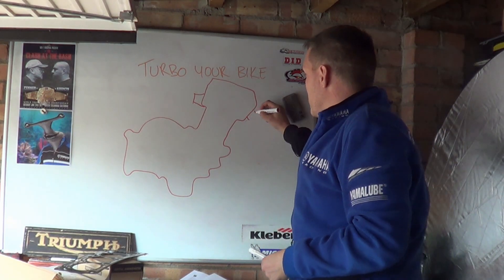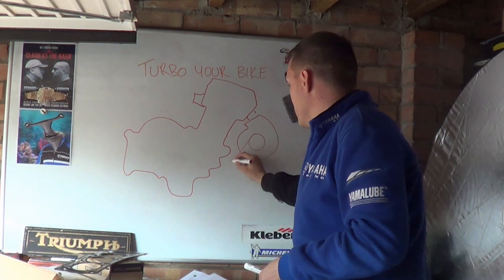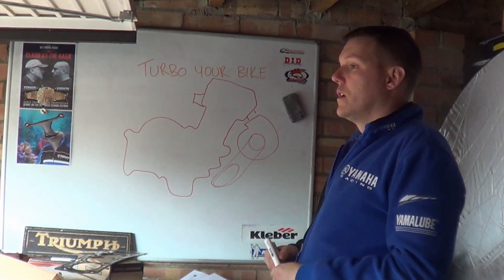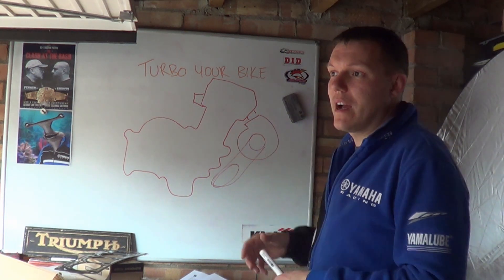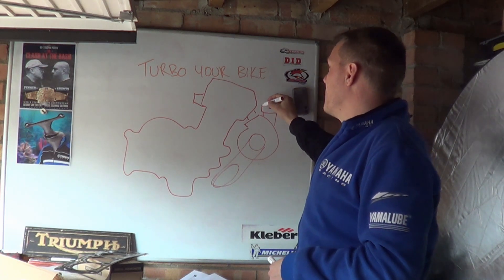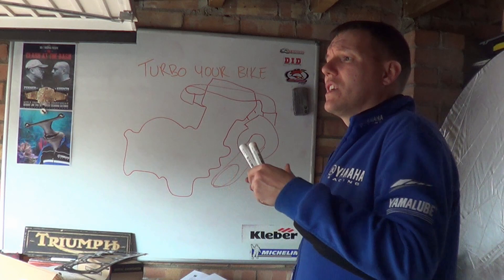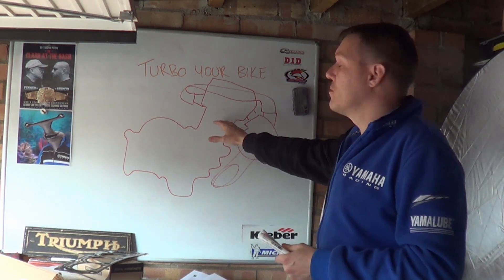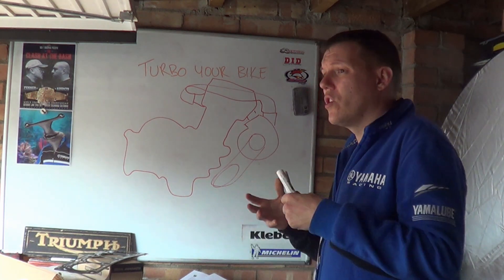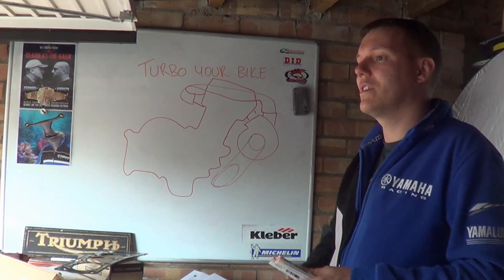What you have to think about is the placement of things. Obviously your exhaust port is here, so you want your turbine sat here somewhere. Then you stick an exhaust on it that might come out like this, or you might actually fit it to an entire exhaust system — it's completely up to you. When you do that, obviously your impeller side — your compression side — is on this side. So you have to work out how you are going to pipe your outlet from your impeller side round to the front of your manifold. Then you have to start to think: do I want intercoolers? That can actually be quite important with bike engines especially, because they rev so high there's a lot more heat soaking throughout the engine. Having an intercooler is actually a really good idea for bikes, but a lot of people run without and it works — though probably two years later they're having real trouble.